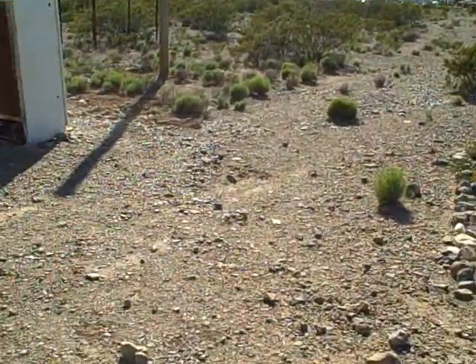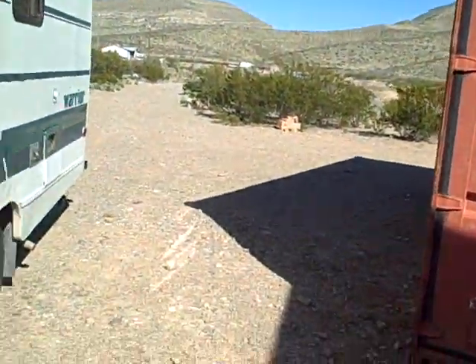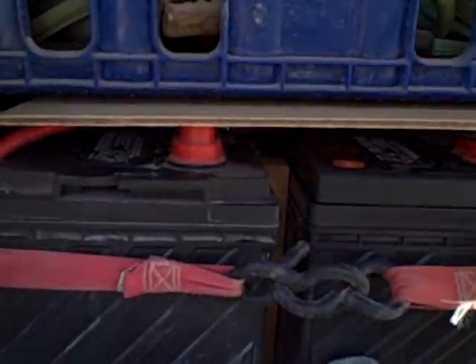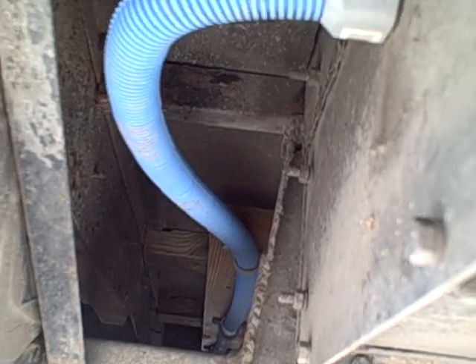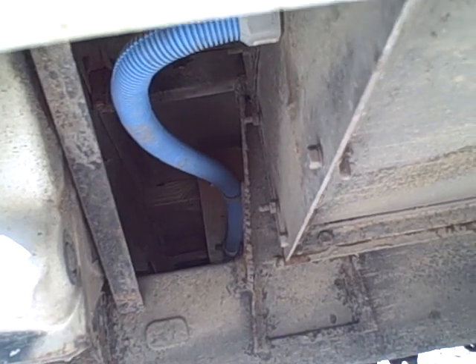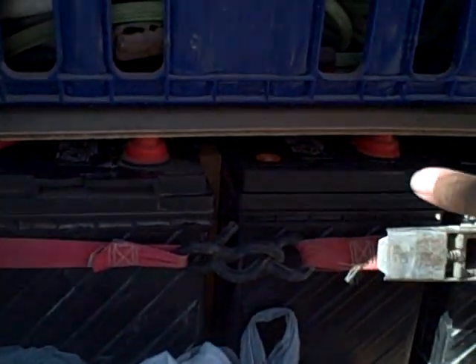When we bought this thing, it didn't have an inboard generator — thankfully. I didn't want it sucking gas out of my gas tank, which is my understanding of what they do. So before we discuss what's in the generator compartment, let's look underneath here. You see that blue line? That's number eight wire, and it comes from that compartment over there next to the door and comes over to here.